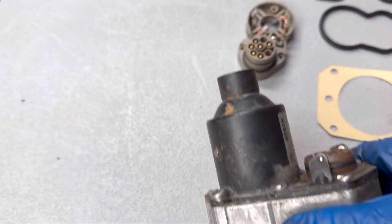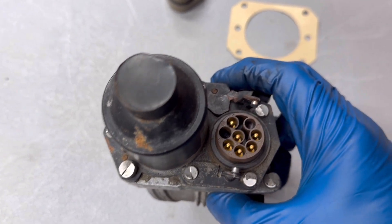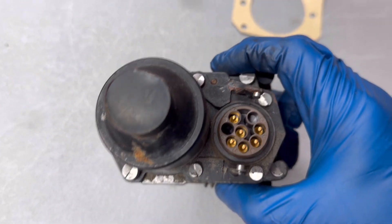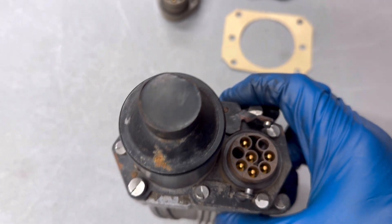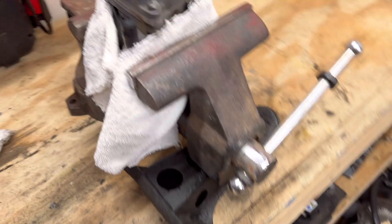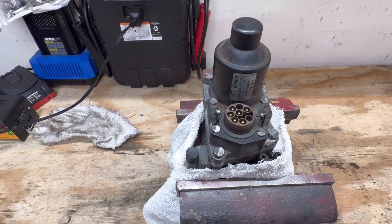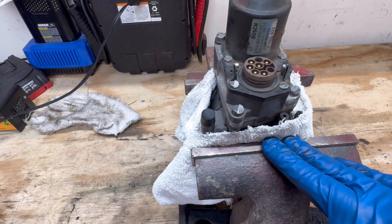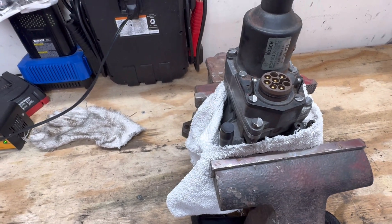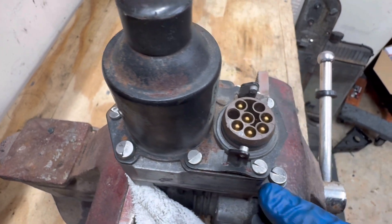This end of the throttle body is where the encoder motor is. The motor is right here, and what we're replacing is this brown piece here. To do that we've got to take the top off, and as you can see there are all security bits, because this is one of the early throttle bodies. The later throttle bodies I think only had a couple of these as security screws, the rest were standard hardware. We need to first set one up in a vise, put a rag around the throttle body so you're not marring up the surface. The one surface you can't see here is actually where it mates to the intake, so we don't want to mess that up — we want a good seal. You don't need to put a ton of force, you just need to hold it still.